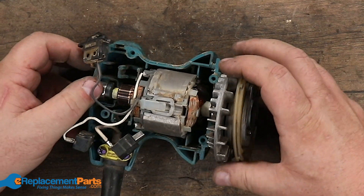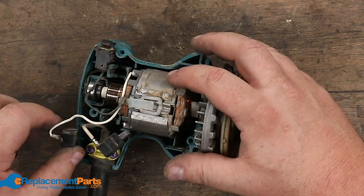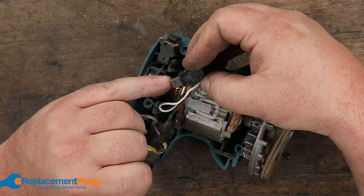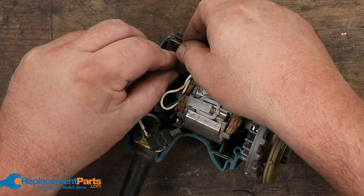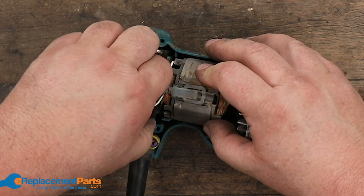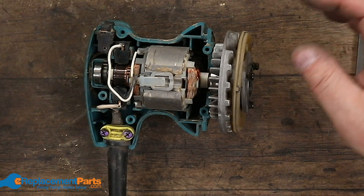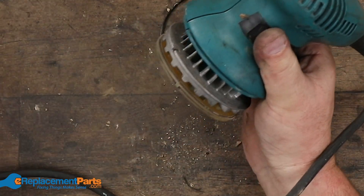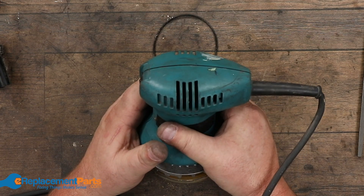You have to make sure your bearings sit in the proper spot. The switch goes right back in here — you can see the bend here, coming up this way. So that's where that one brush goes. You can tell as well, if you look at the curvature of the wear pattern, you can see which way the brush goes. Of course you have to push the brush in. Same thing with this brush — turn the brush, put it in there, compress the brush against the spring. I'll give it a quick turn or two just to make sure everything sits good. Then it's a matter of reassembly. Once we have it closed up, we can give it a quick turn to make sure everything sounds good inside. We'll put our O-ring back on, which is our dust shield, put our two bottom pieces back on, and we're ready to plug it in and give it a final test.